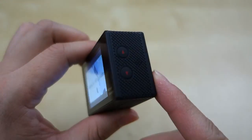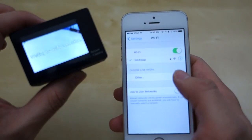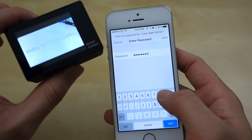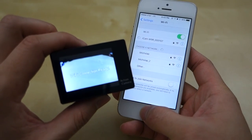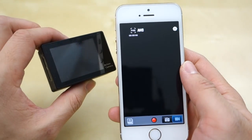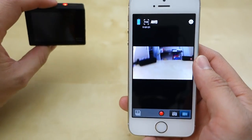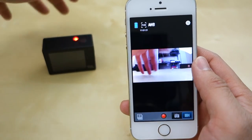To start the Wi-Fi connection, just press the down button and it will start. On your phone, pick the Wi-Fi network to connect to — it's called iCam — and the password is 1234567890. Once connected it says Wi-Fi connection is ready. The app we use is called iSmart DV; launch it, it takes a second, and then you get the video feed. The feed is actually pretty good, but it does cut out at range and can lag sometimes.